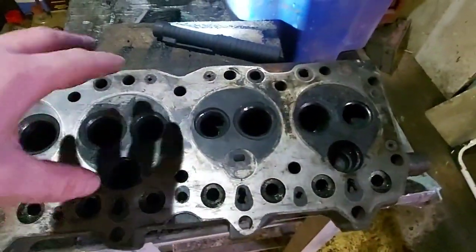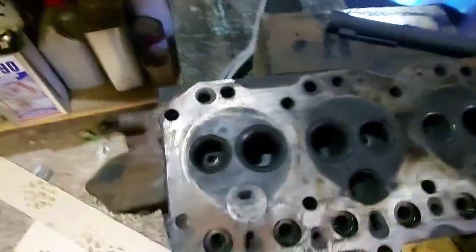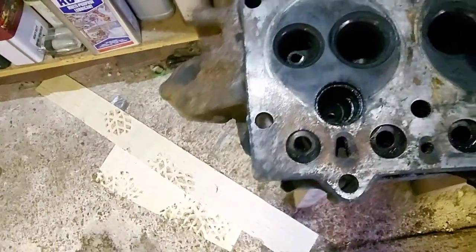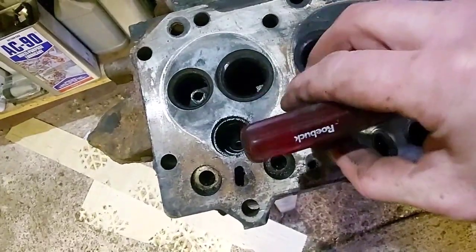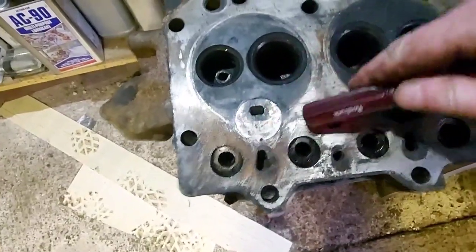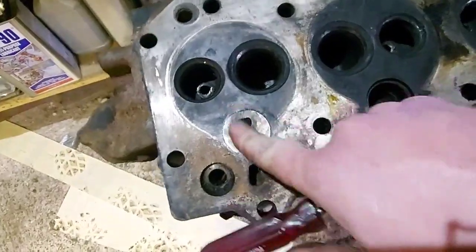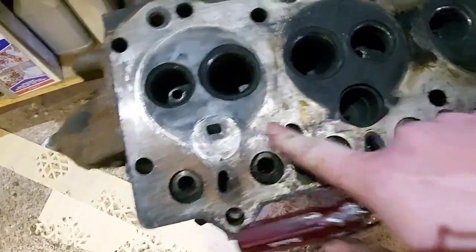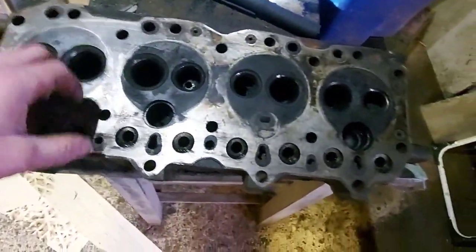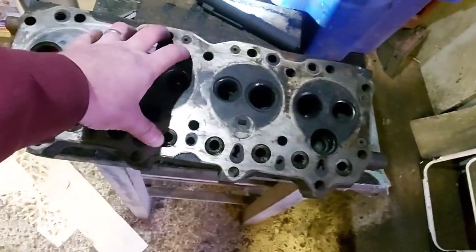So it's just a word of caution. If you do have your head skimmed, check that the hot spots are staying in place and not just going to fall out. The milling process, obviously, because it's literally a friction fit, so it can move about a little bit, and yeah, lead to total destruction. So just check.